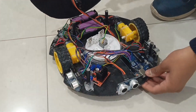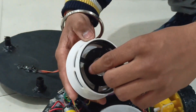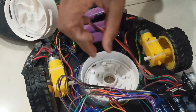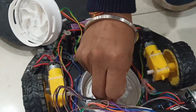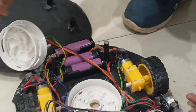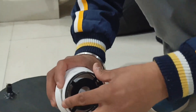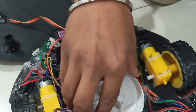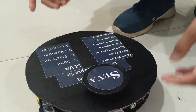Now I will show you how to clean the robot after it has cleaned the floor. You can easily remove its rooftop and simply remove the upper part of the vacuum cleaner by twisting it and it will come out. Here is the filter of the vacuum cleaner — we can simply remove the dust from it using a brush. Here is a container where all the sucked-up particles are collected. We can easily empty it, refit the filter, align it with the mark, and it is ready to go and clean again.